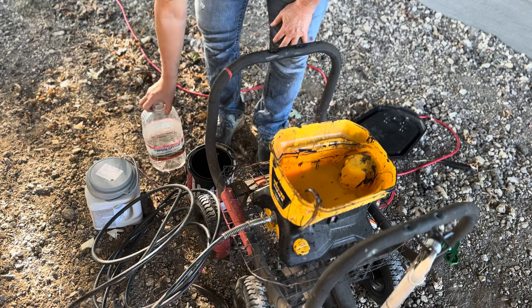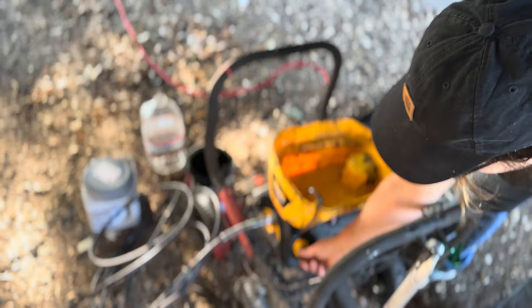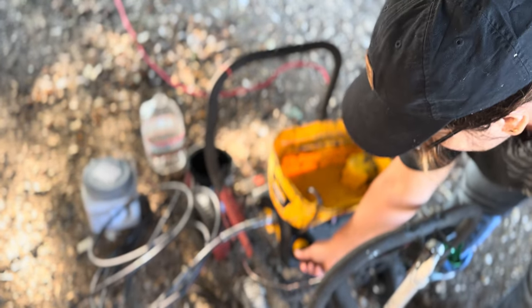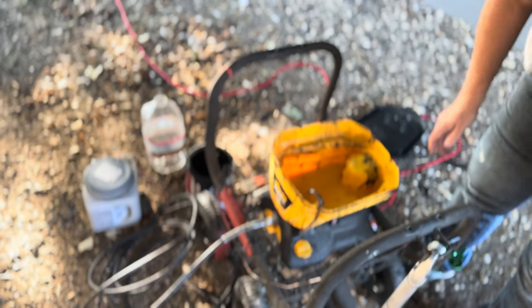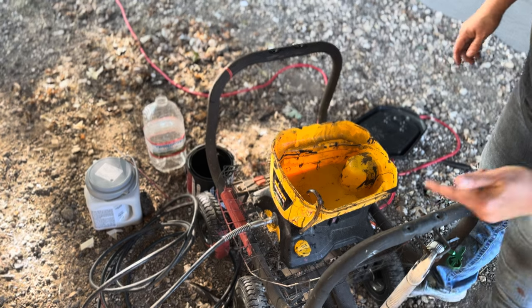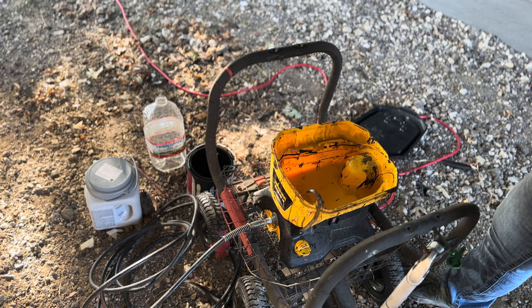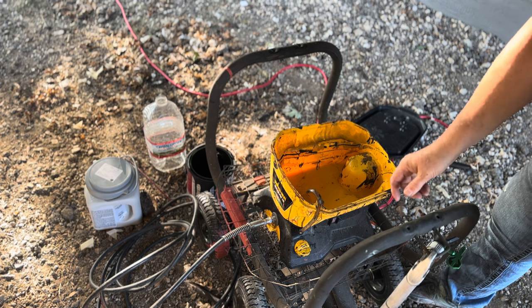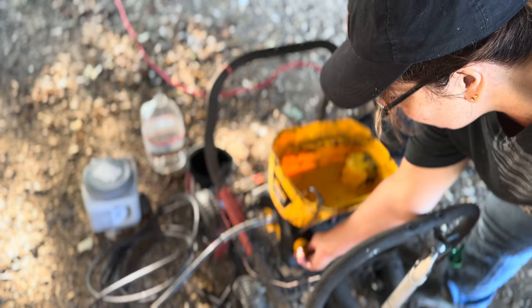like that, and when you turn it on, turn the knob vertical, that primes it, and then when you turn the knob horizontal, it primes the hose, so it will run until it primes the hose. And it doesn't matter if you turn it right or left, the knob turns.